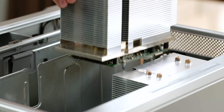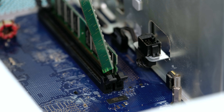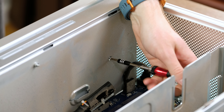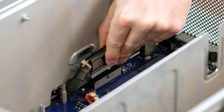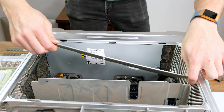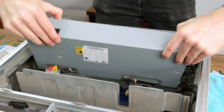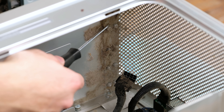I'll be sure to apply some new thermal paste later in the video. The RAM was next to come out — I'm very surprised how much dust had built up on these over the years. The power supply in this G5 is hidden away underneath a metal plate held in place by two Phillips-head screws. I unplugged all of the power connections and unscrewed the metal plate. When pushed forward, the dusty plate finally came out revealing the massive power supply within. With some careful maneuvering it was free. The lack of any dust filters really makes the Power Mac G5 a dust collection champion.